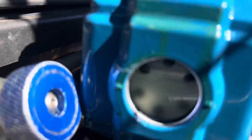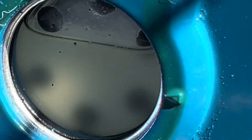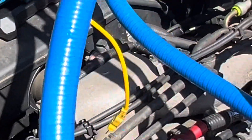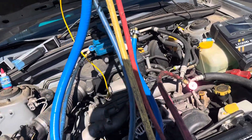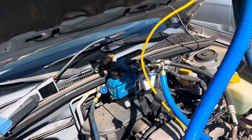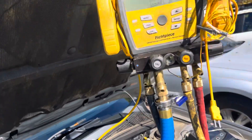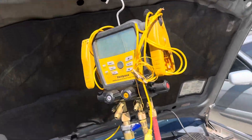Check out this oil — this is one oil job. This was crystal clear when I started; that is all water from this car. If you remember from the first video, this had zero PSI in it — super moisture contaminated. It loaded up my vacuum pump oil, which is that expensive oil, just on this car alone.